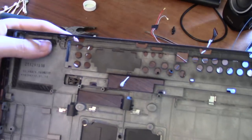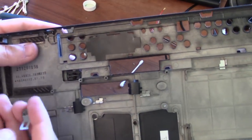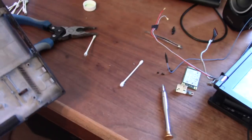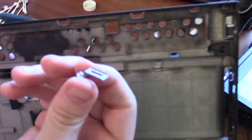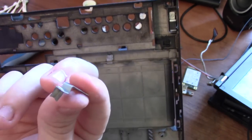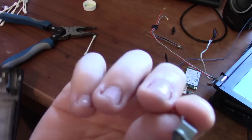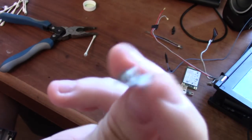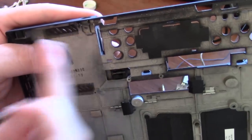In the process of taking my computer apart, I actually realized there was a little part broken on the case of the laptop — this little thing where the power cord goes in. There's a little yellow connector that's supposed to have a piece on top of it that screws in, but the whole screw had come out. I didn't do this myself — it looks like I must have dropped my laptop at some point and it broke. So I'm going to unscrew the screw from the plastic part and then super glue it back where it belongs, just for that little bit of stability.